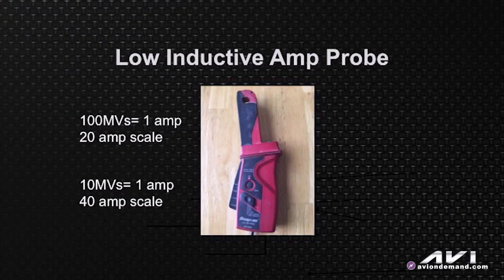To be more emphatic here, it's really important to get acclimated to using the min-max peak detect record mode of your multimeter. On my screen you can see the first setting is 100 millivolts equals 1 amp, giving you the 0 to 20 amp scale when current-clamping something like a fuel pump. If you have something that pulls more than 20 amps, we can go to 10 millivolts per division equals 1 amp — and we'll use both of those during the hands-on on the car.